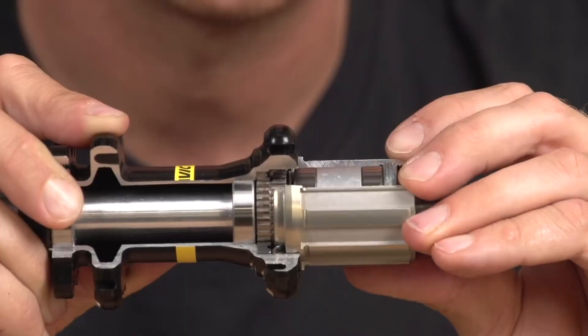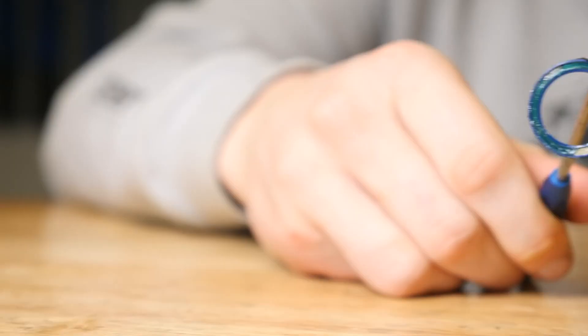There are two main types of freehub: a ratchet-style system with two rings that interface with each other and springs on either side — those don't tend to get gunked up enough to cause this. The other is the pawl-style — P-A-W-L — which has little tiny springs behind the pawls. When those springs get gunked up, the pawls don't push back onto the inner ring properly, causing slipping or sticking — which is probably your issue. You need to do a freehub body service. There should be a linked video below; if not, let me know and I'll make that one next week.